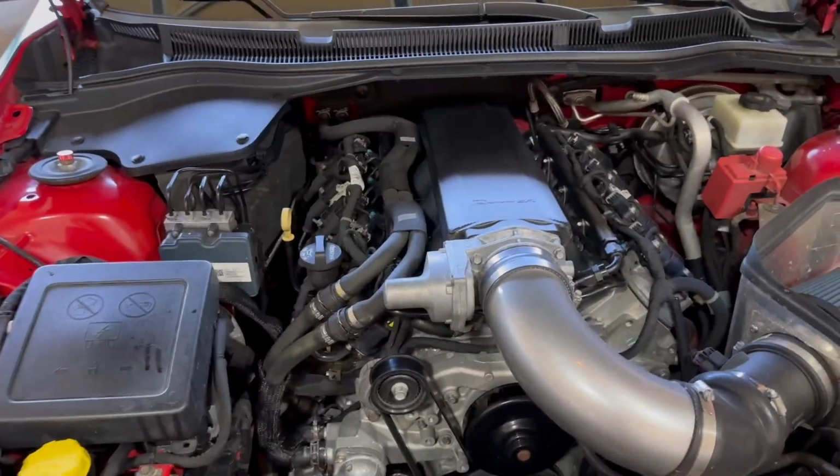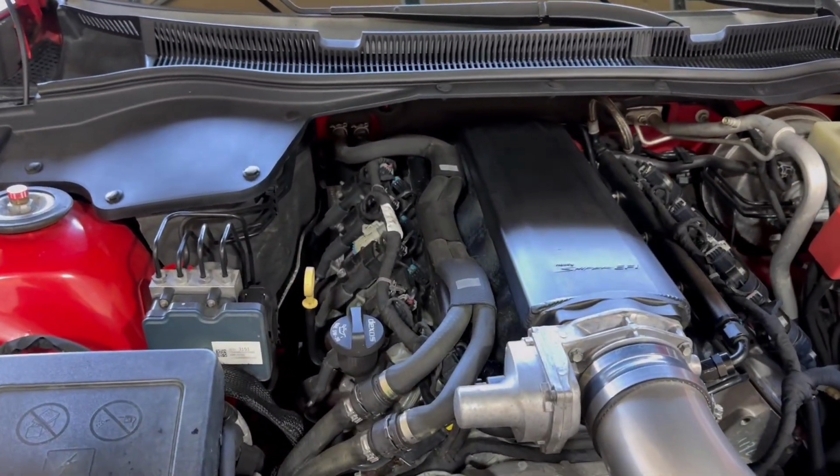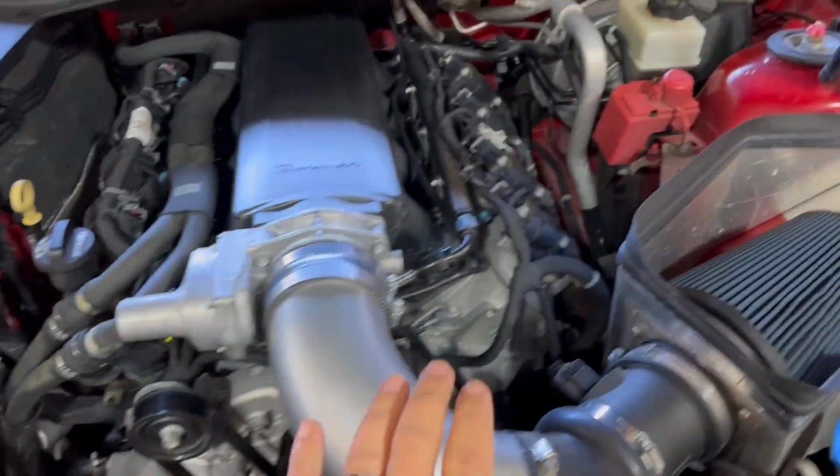So my plan is with this car, it's going to take some work, but I do want to do forward facing and like mid mount turbos in the engine bay, potentially sticking out of the hood slightly. We'll see. These turbos, with all the supporting mods, with the built motor that I have, should be capable of producing well over 1,000 horsepower. And I'll tell you, I am not trying to make that much power. I'm looking to maybe make 850 to 1,000 at peak to have that number, right? But drivable, I want to make about 800 to 850. So it shouldn't be hard from where I'm at with these turbos. It should be super easy work for them.